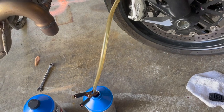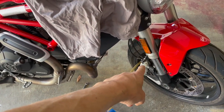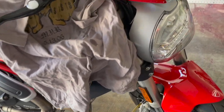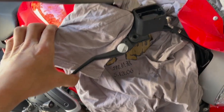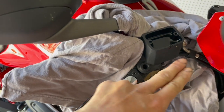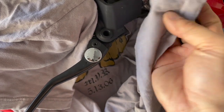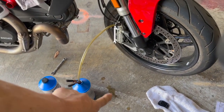Now down here, what you do is when you release the bleed valve, you squeeze the lever. The fluid just popped out because there's no cover on the reservoir. That's the nature of how brake fluid works — when you squeeze the lever, some brake fluid can shoot back up. I need to wipe off this little bit right here. Good thing it shot forward and not onto the gas tank. You can see it's all wet on the floor there.